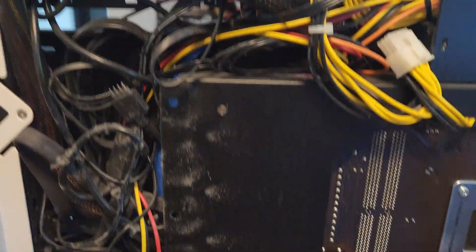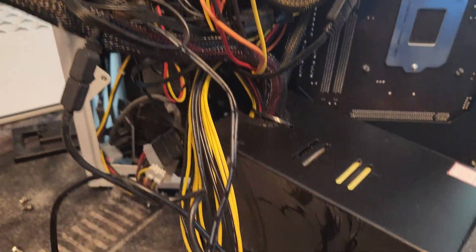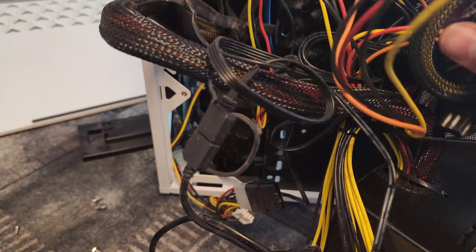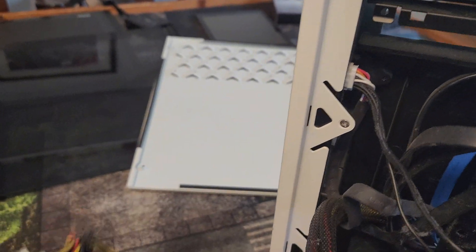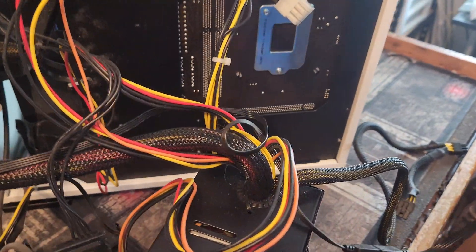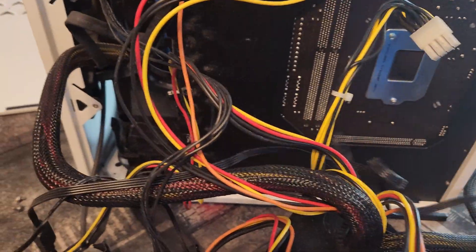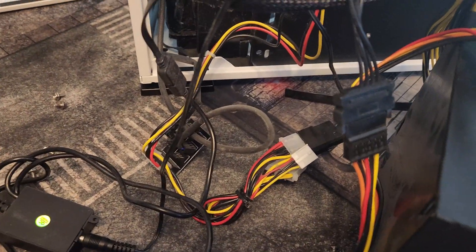The back is still pretty dusty — I'm going to blow it out — but let's take this power supply out. There's a mess of wires in here, so I'm glad I did this. You want to make sure everything's powered correctly. The first red flag is a SATA adapter. SATA adapters are never good. It looks like it's just powering the fan hub and some LEDs, which is probably safe, but if you're buying this from somebody you don't know, I wouldn't trust it. So the first thing we want to do is remove that.